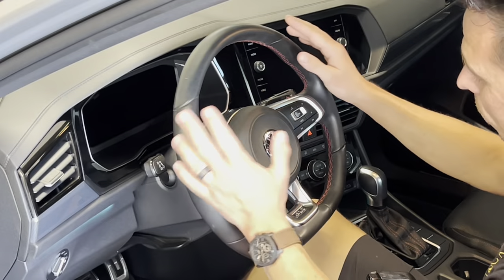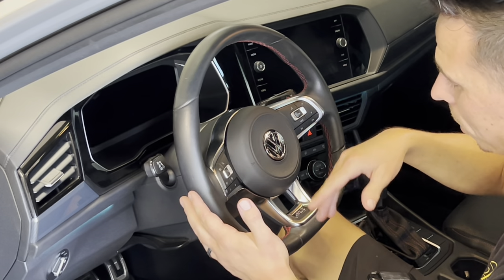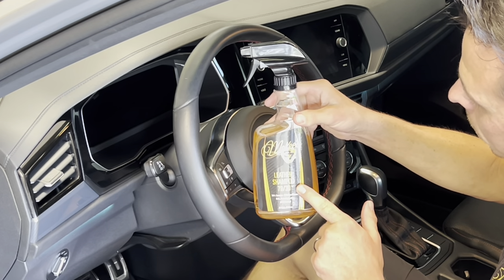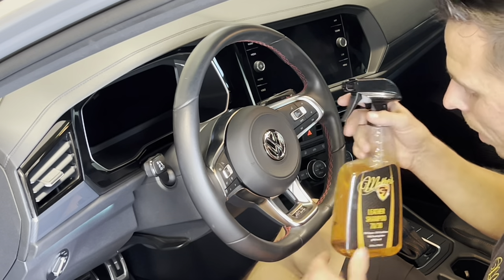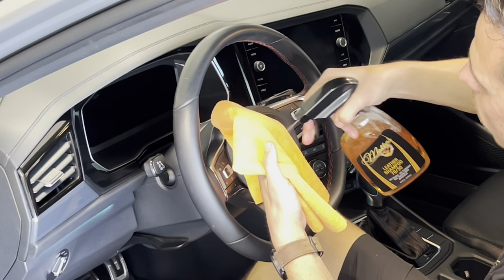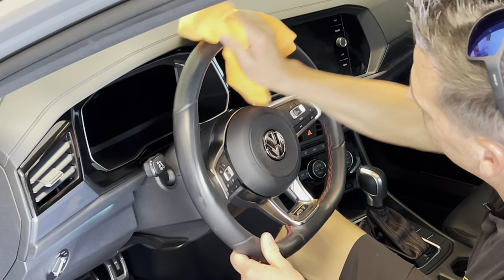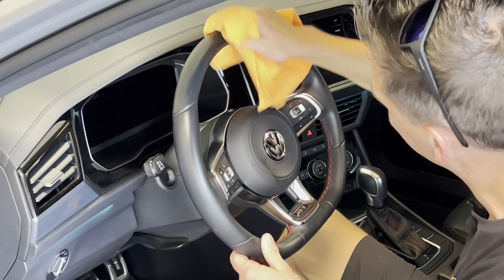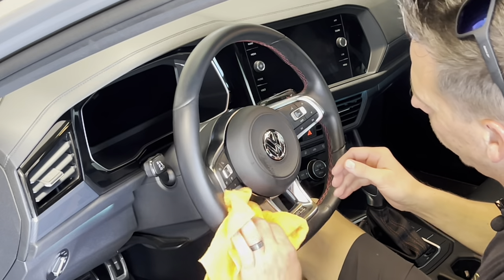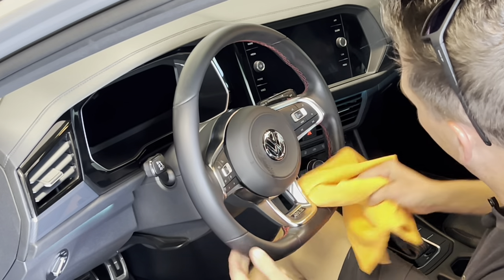The next thing I like to clean is the steering wheel. I've used Total Interior Cleaner on virtually everything else — the rubber, plastics, and dashboard. For the steering wheel, which is leather on this vehicle, I'll use McKees37 Leather Shampoo 70-30 — 70% cleaner and 30% conditioner. This will clean any skin oil, suntan lotion, or body lotion off the steering wheel and help preserve the leather. Dirt and oil over time will wreak havoc on your leather steering wheel. I'll spray it on a fresh towel and massage it into the steering wheel.